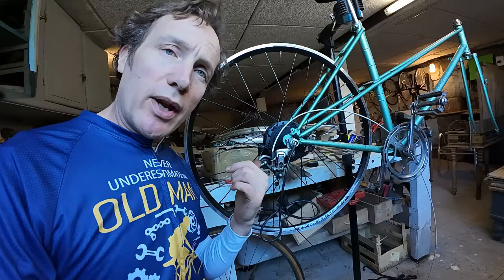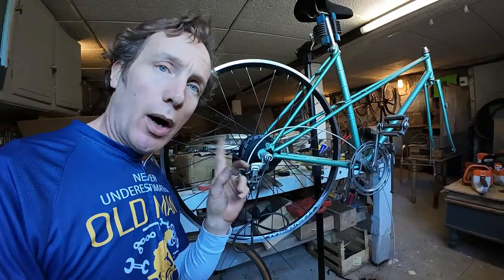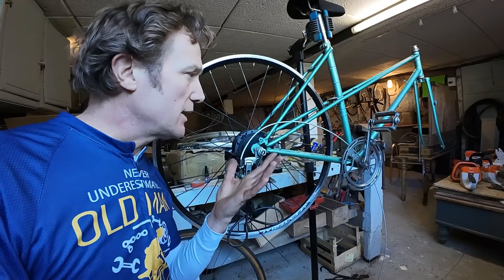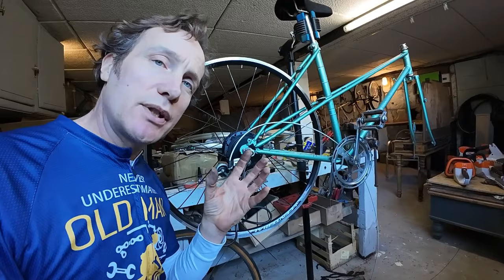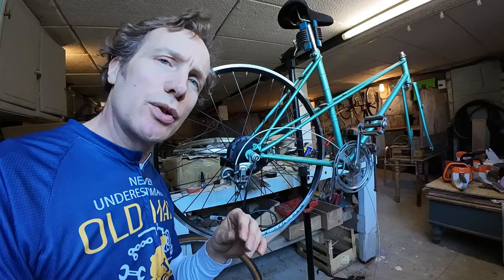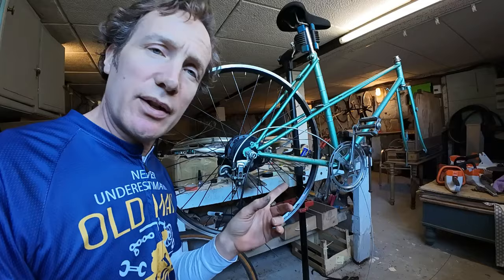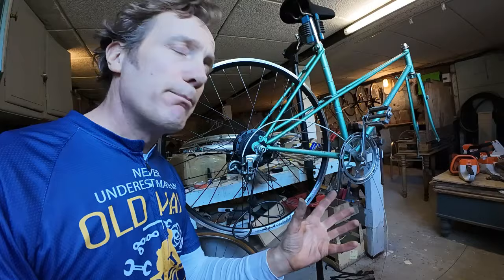Some good news — a bit of progress. We've got the bike fairly stripped down and the rear hub motor is in place, just a trial fit to make sure we haven't got any issues with fouling or anything like that. It's a little bit tight but it is in there and we are not fouling. I've also got to tidy up the paint. I can't get a paint match for this — it's some kind of strange turquoise colour and I've failed to match it. So I'm going to clean the frame up and coat it in a green pearlescent that will cover up some of the worst problems, then clear coat it after that. I've also got to get the cranks off because you have to put a crank sensor on there for it to know the pedals are spinning, to allow the motor to assist.